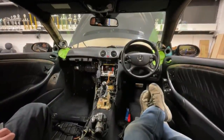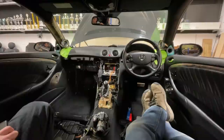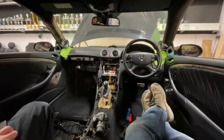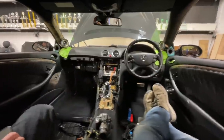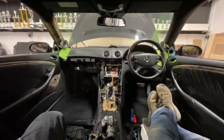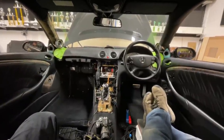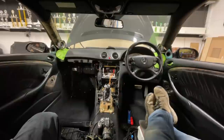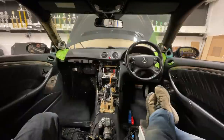Yeah, these mid-range speakers are not that simple to install due to the shape of it. They made it half circular, half oblong, funky. At least we could 3D print the mounting, that makes life easier. Once we have the speaker grills on, everything trimmed, it will blend in nicely. But yeah, the mids are going to be quite off-axis because they will easily play up to beaming point, even off-axis. But yeah, this is another daily car and it has to be practical as well. We don't like blocking the view as much.